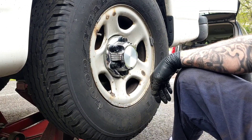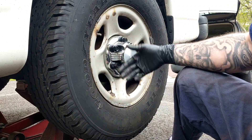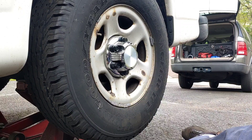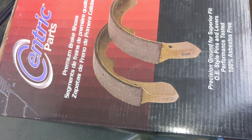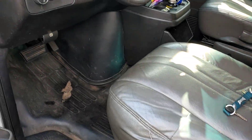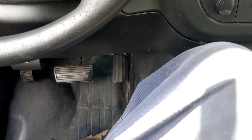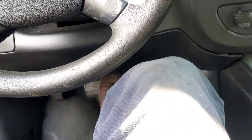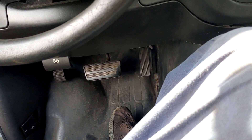And that's it — that's how you replace the parking brakes. The other side I have to torque down; there's no need for me to show you that. I've got to put this back on and drop it down, and that's it. Hopefully that helps somebody because these are pretty easy to do. It's actually the first time I've ever done these, but if you know how to use tools you should be able to figure it out. Also, since you pushed back those pistons, make sure you pump the brakes — just so you don't message me complaining that I didn't say it.